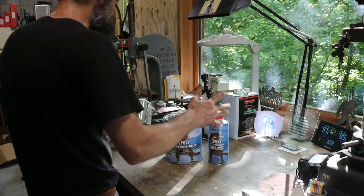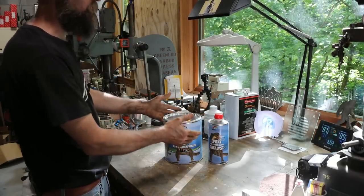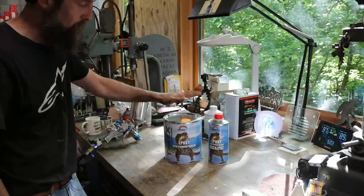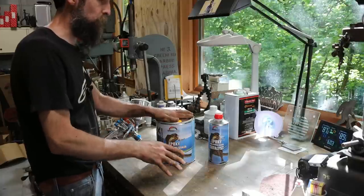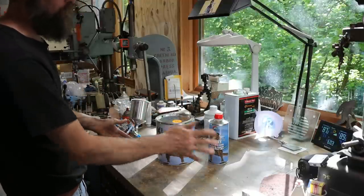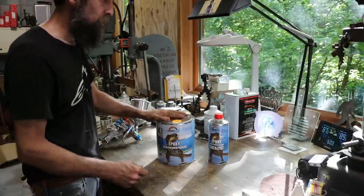So I had a viewer in my last week's video ask, don't you like epoxy primer? Because they haven't seen me use this stuff in this project so far. And the answer is yes, I've got a gallon of it. My issue with epoxy primer is that it never sands well. It's not good for something that you want to spray over bodywork and then put paint over that. Really, it's more of a protecting layer than anything else.